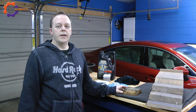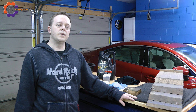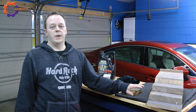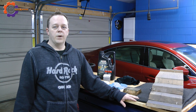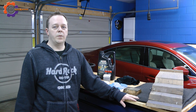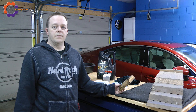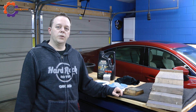We'll first start with some of the safety items. I'm going to need to get the vehicle up off the ground so that I can get to the oil filter and the oil pan hole. The way I'm going to do it is with a ramp like this — it's made out of wood. You can go to any auto parts store or Amazon and buy ramps. I recommend ramps over a jack because you're going to be putting your whole body up there. Don't take the chance on the vehicle falling or rolling backwards. Also make sure you have some type of block behind the rear wheel so the vehicle doesn't roll back and crush you when you're underneath.